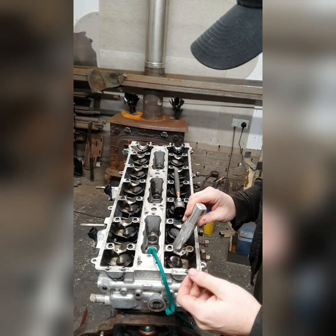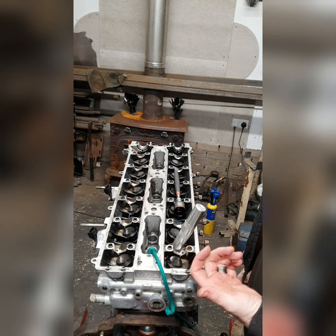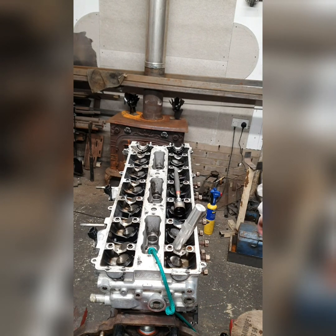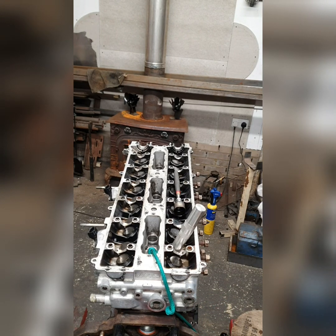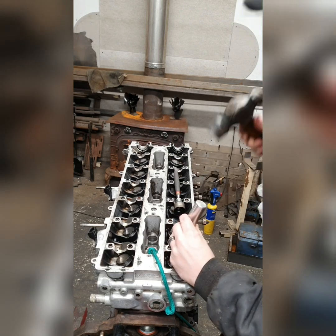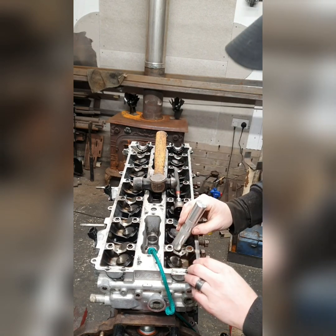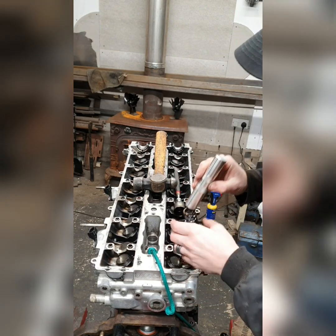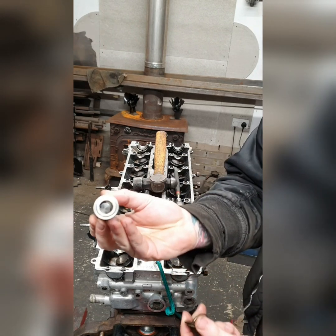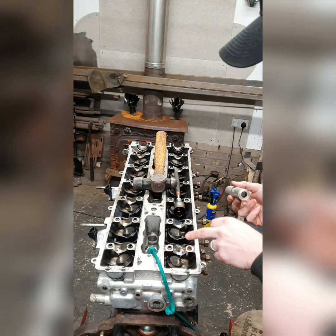What you do is put it right there on top of the cap, making sure that the centre hole is in the middle of where the valve is. You then take a good and trusty hammer and give it a whack. And then - da da da - spring, cap, and right in there the collets holding it together. And there's your valve. So now you can change the stem seals.